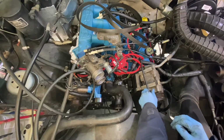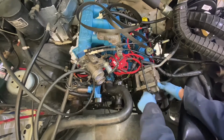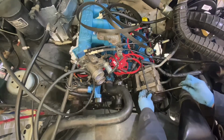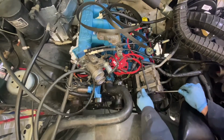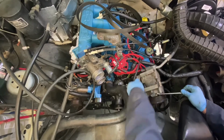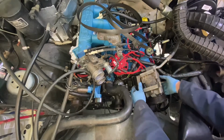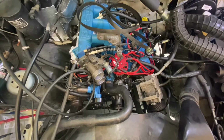And I'm going to go ahead and unplug, ever so carefully, my AC clutch, if I can do it without breaking the clip. It's cold outside right now, so I really don't want to start breaking plastic clips. Just got one clip on one side of it. So I'll move that back out of the way. You'll go broke trying to buy those clips. That stud is going to be 5/8.